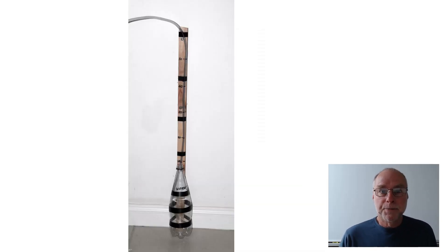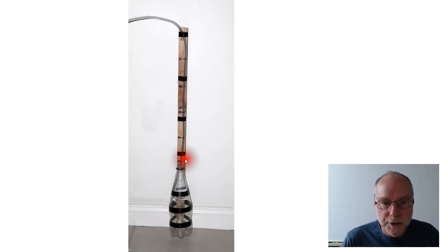So how do you actually measure the pressures? Here's a zero-cost way of doing it — a handmade water manometer. We've got a plastic bottle filled with water to a certain mark. Behind the bottle, taped to it, is a piece of timber with measurements in centimeters going up it. We have a clear plastic hose that goes into the water. These measurements are above the water level, so you always have to fill it to the right level. The other part of the hose goes to that pressure tapping point. Make sure it's before the throttle body — not after.